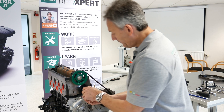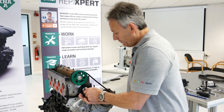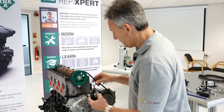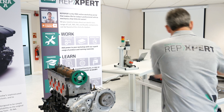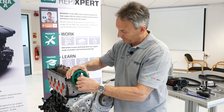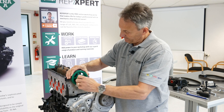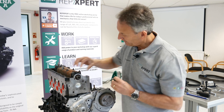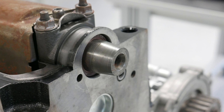I'm now going to remove the tensioner and the belt, but just before I put the new belt on and tensioner I want to show you why we are releasing the camshaft gear. If I pop this off you will see that the camshaft is on a taper.